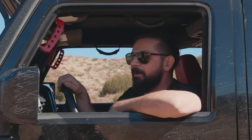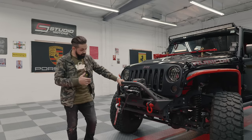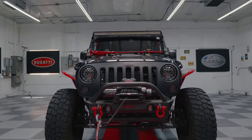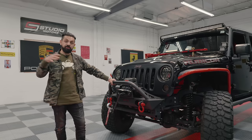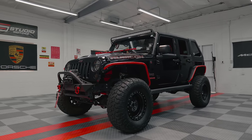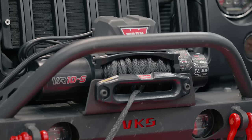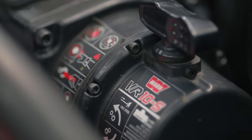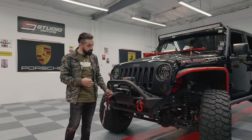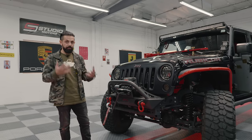I'm having a really good time out here — it feels better than it's ever felt. The front bumper I bought from a company called VKS; they make great products, based in California, and they really accommodated me. When it came to picking out the winch, I didn't want to skimp — we did have a couple of close calls. We went with the Warn VR10S. The 'S' just means synthetic rope instead of steel cable; it's just as strong, much easier to wind back in, and if it snaps it doesn't kill anybody. I highly recommend it — when it comes to safety equipment, go with a good reputable company.